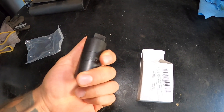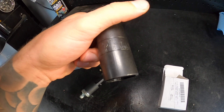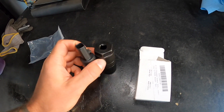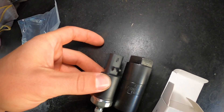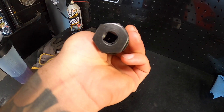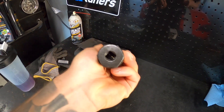Here is the socket — it's only about seven or eight bucks, so I'll link it for you guys. This is a specific socket for this task: it is an inch and one sixteenth. Some guys were saying about being able to put the three-eighths drive in there, but by the time you put the length of the new sensor in, it pretty much bottoms out in the socket and can push your three-eighths drive out. So this socket fits beautifully. If you absolutely have to use a three-eighths, you can play with the orientation of your sensor so that the hole isn't blocked before you install it.